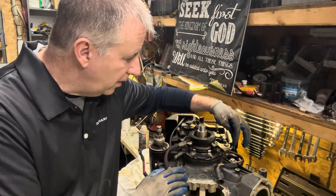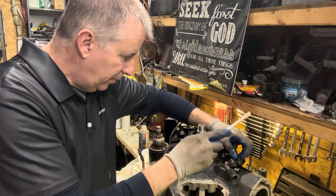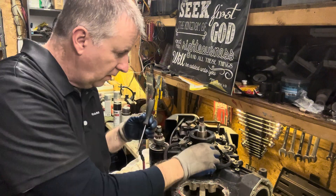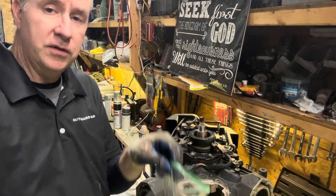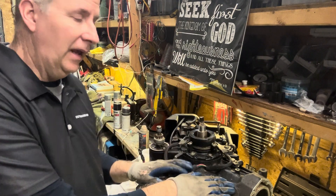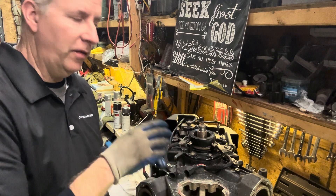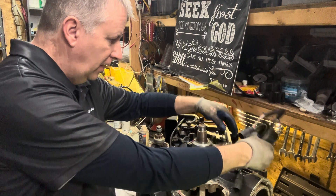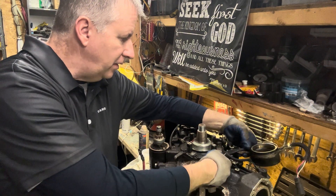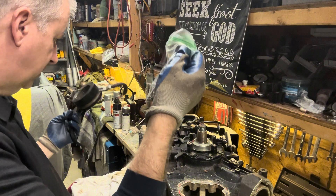So we're just going to disconnect it off of here — we want to make sure we don't break any linkage pieces. We can open these up a little bit so the wires can come out. There are just some screws in here holding this in place — these little clips. I took all of those clips and screws plus all of the bolts that hold on all of my coils and my regulator plate, my bolts that held my stator down — all of those are going to be in one baggie so I know that's what I used for it. It's just going to slide off and then we just have to disconnect it from here. We want to be careful — we're going to pry this out but we don't want to break the plastic. And there's your trigger base, and here's all our electronic bolts, so I'm going to seal that up.